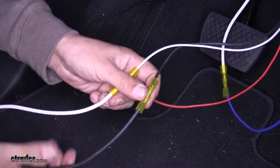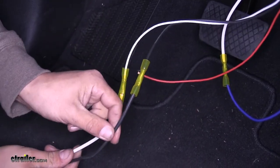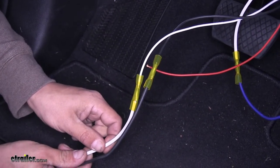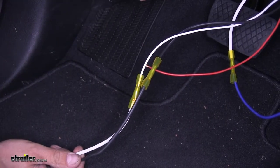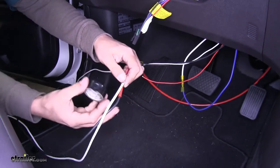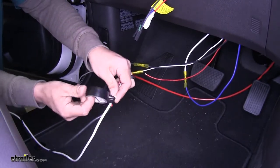Our black and white wire are going to need to go into the engine bay so we can hook our black wire up to that other breaker and our ground wire is going to need to go directly to the negative side on the battery. Use that same method of airline tubing going through the engine bay. Secure our black wire and our white wire to the airline tube and pull it into the engine bay. Take a little bit of electrical tape and wrap it around both the wire and the airline tube since now it's two wires going through — it may be a little bit difficult getting it through that grommet and you don't want to lose it when you start pulling.